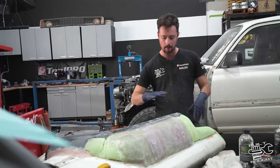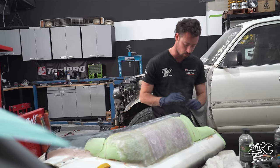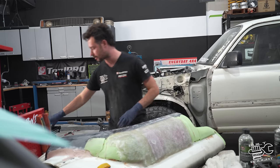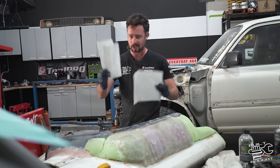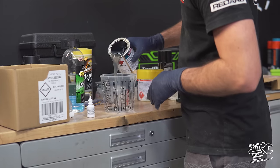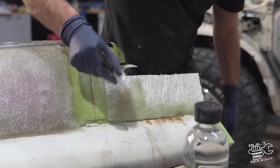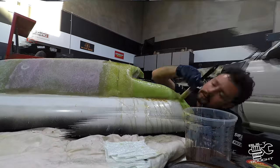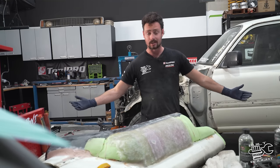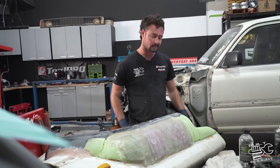I'm going to mix up a massive amount of resin. I'm pretty happy with how the foam has been shaped — I've been putting the headlight in and out a couple of times and trimmed it back. I've cut up three different sizes of matting: small, medium, and large. You want to lay a first layer of resin onto all the foam, let it soak in, then before it dries get that first layer of fiberglass on, lay the resin again, keep going for three or four layers. It's one big experiment but I'm keen to get this whole thing properly glassed so it's more rigid.